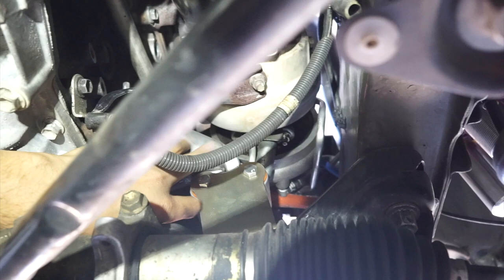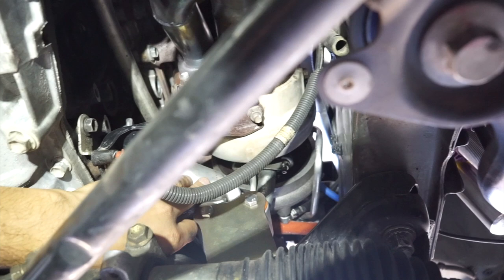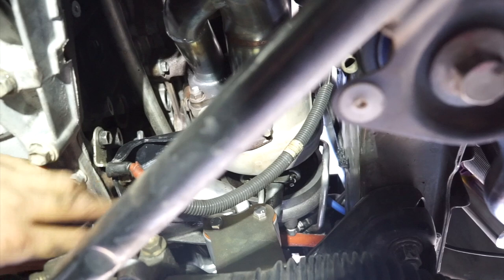Now the engine bracket, so the one that comes on the 1J, it looks similar to the OEM IS300 engine brackets, but I was reading around and it said that if you use the 110 or 171 brackets, your engine will sit too far forward, I think. Anyway, that's what I read, so I actually went ahead and swapped out the engine bracket.